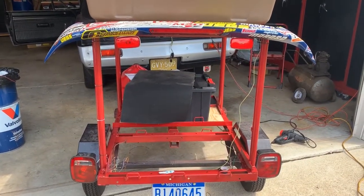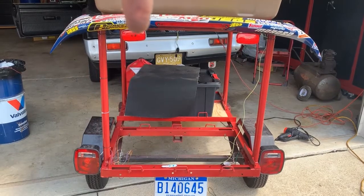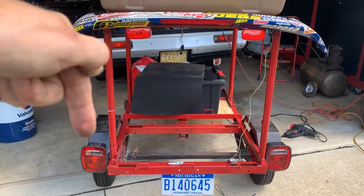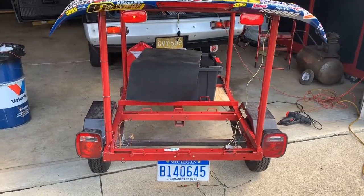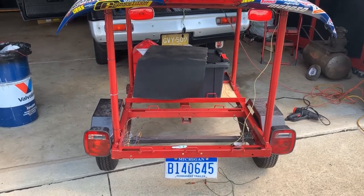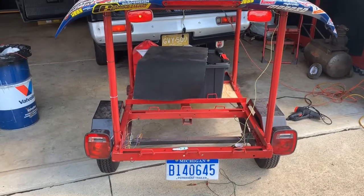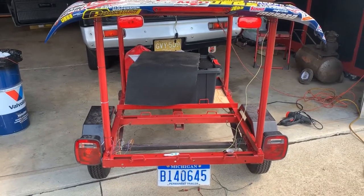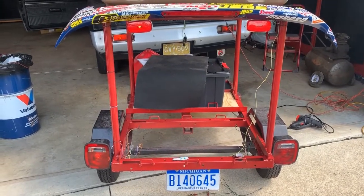As you can see, I've got the upper lights installed here and here on the trailer, and you can see it blinking along with the left rear tail light. If I flip it over it does the same on the other side, and if I hit the brakes all four of them come on. The only two that will be running lights are the two bottom ones - I couldn't get the third one working up there so I gave up on it. But at least now I've got extra brake lights and extra turn signals up top so people can clearly see when I'm stopping and turning.